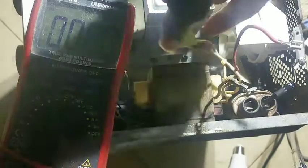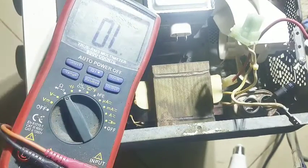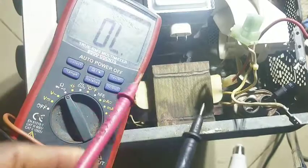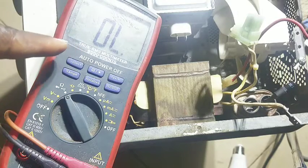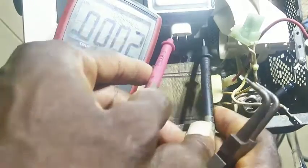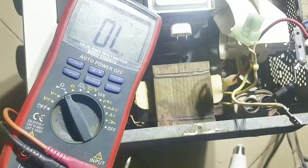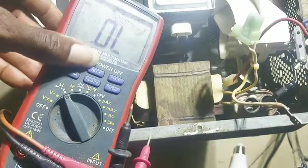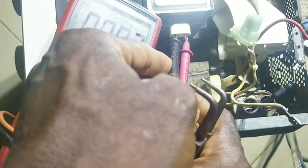What next do we need to test? We need to test the magnetron. Let me shift this aside and take the multimeter to resistance. I don't think the continuity test is actually reliable here because if the magnetron is shot inside, continuity will still read. I don't think that's the right way to test it, but that's the way I've been seeing a lot of people test it. I think it's generating some power because I'm seeing it beeping my battery, so I'm gonna change it to ohmic values.